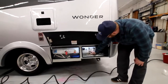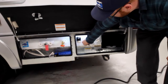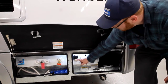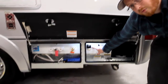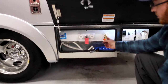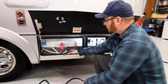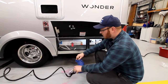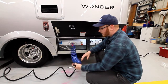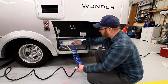Next to the Sanicon flush, we have our cable hookup — we can hook up our cable here, or if we have satellite, we can hook it up here, meaning like a satellite dish. Next to that, we have a water pump. This water pump works from the fresh tank, which holds fresh water. It'll pump it into our city connections — our toilet, faucet, and shower. This is the connection where you put your garden hose in to add water to your whole water system.